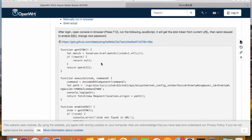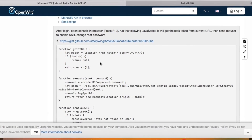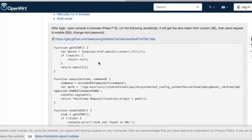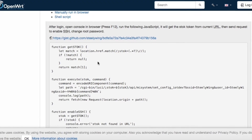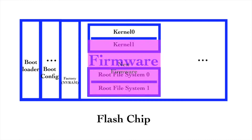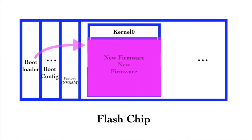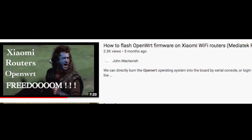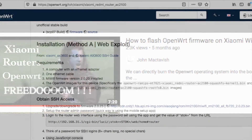The latest solution from 2021 is easier, and the main difference is the part of getting into the stock firmware. After getting in, the old things are the same, such as flashing the images into partitions, setting up NVRAM, etc. If you are not sure about the partition and boot sequence, please check that video first. Ok, let's get started.